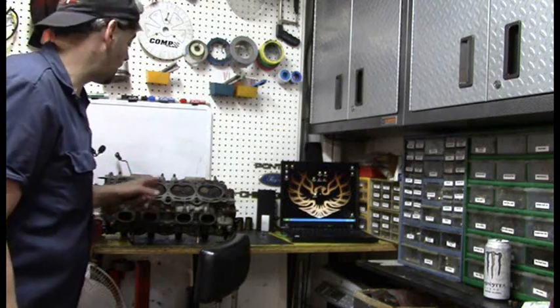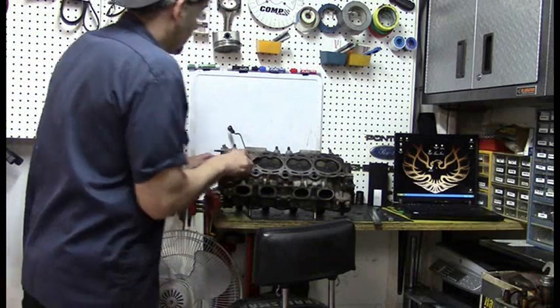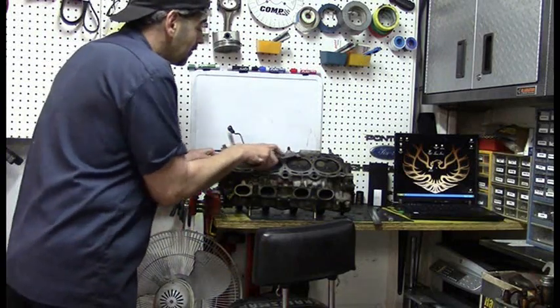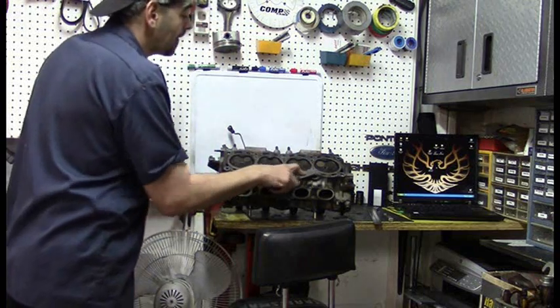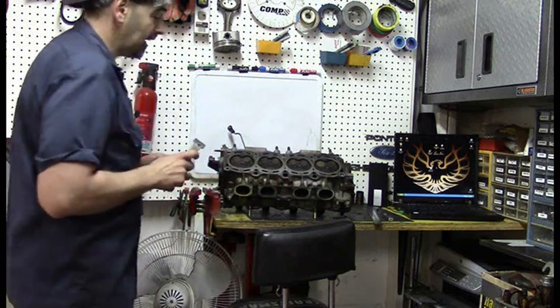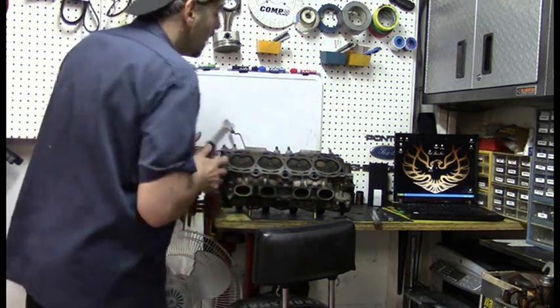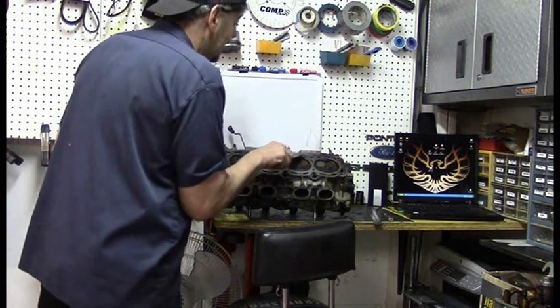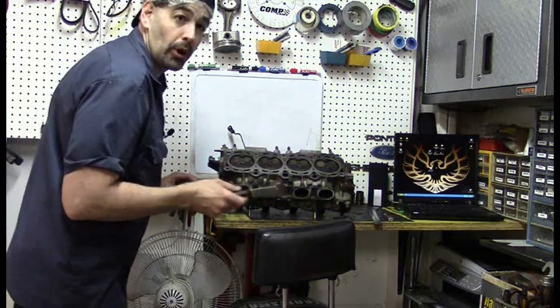In this case we're going to see a pretty severe warp in the cylinder head. The first thing I'm going to do is scrape any gasket material off the cylinder head. A wire wheel on a drill works pretty good for this, and another really good technique is some sandpaper on a wooden block so it's perfectly flat. You want to make sure you get any gasket material off so that it doesn't affect the reading we're going to do next.